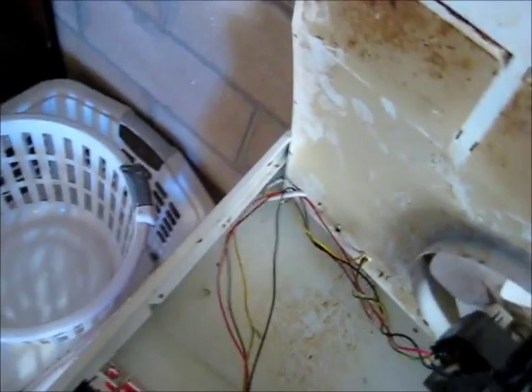They're very, very low quality switches - you can see the insides. I'll pop the switches out, seal them up in a plastic bag, pull the fan blade off so it gets washed, and seal the motor up in a plastic bag with some sticky tape. Just soak all that in degreaser. The batten holder wouldn't matter - that connection wouldn't matter if it gets wet. I'll wash them in contact cleaner afterwards and blow them out with compressed air to dry them. It's the switches I'm concerned about because they've got contacts and bearings in there - I don't want them wrecked with degreaser.